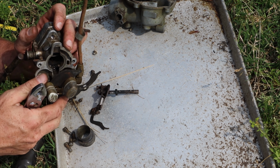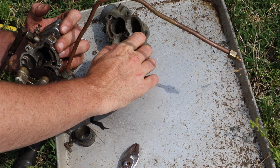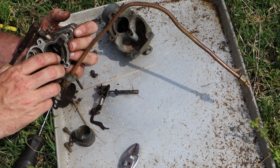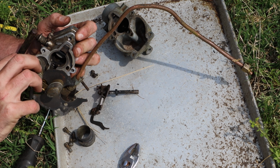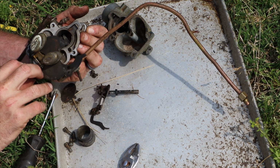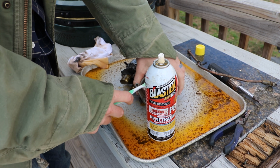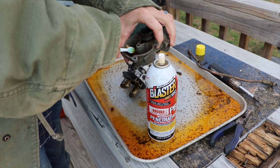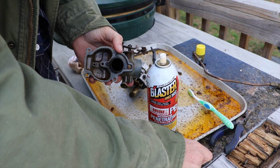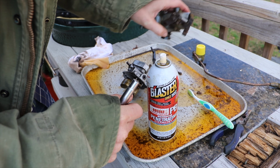My carburetor problem, the pin isn't dropping at all right now when this goes down. So when I took this apart, there was no fuel in there whatsoever. Still taking it apart to clean it better, but the pin that allows fuel into the carburetor appears to be stuck. There's something that has been growing up inside there. Ugh.